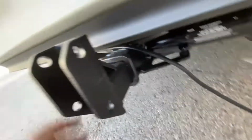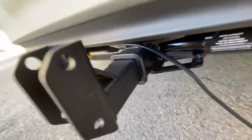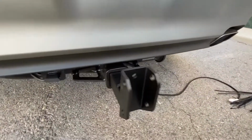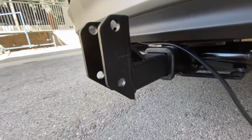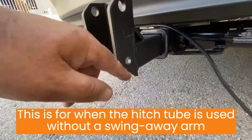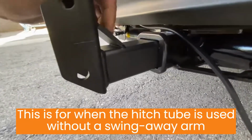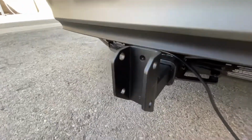I always try and get it close to the vehicle as possible, but not so that it's going to damage the vehicle. It's usually so that it clears the bumper of the vehicle. And always facing upwards like that. You can do it upside down, but it's not recommended. If you have a higher vehicle you may get away with it, but you've got this slant there where the roller rolls up, and that support bracket there to give you more strength, more rigidity.